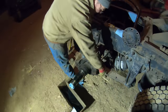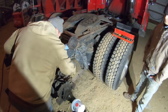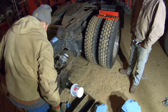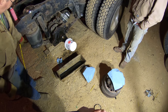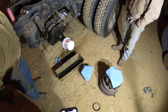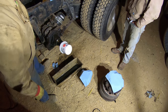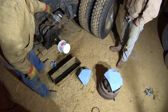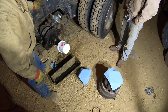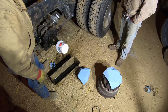All it is, is you take these four bolts out and this tube here pulls out. Your bushing is here and there - you just replace this tube. We're going to replace this airbag while we're right here with the wheels off. The bottom of the airline airbag comes off. We're going to take that brake chamber off, cut it to the right length. We can ratchet the adjustment any place we want it. Just got to cut that off to the right length and put it back on.